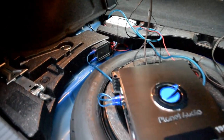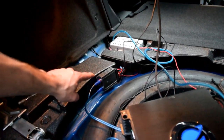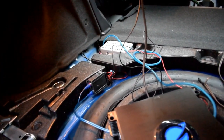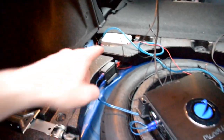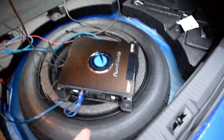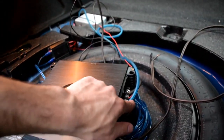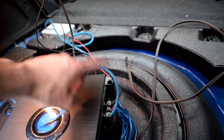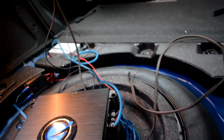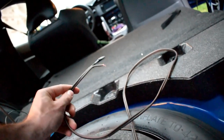Once you've got the line-out converter all wired up, you're going to put in the connecting RCA cables that run from the line-out to the amp and connect those. There's a little adjustment on the converter — the more money you spend on it the better it gets. Then set all your adjustments down on the amp. Over on the big amp you're going to run your power from up front, this is your turn-on from the line-out converter, the black one is your ground which goes together with the other ground, and then you just set positive and negative for the sub wires that run right into the side of the sub. It took me a couple of hours.